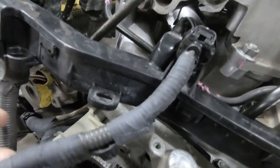You will see in this case here, I've already done some work on this one, because the man sent me the start loom. If I get sent the start loom, I will modify it accordingly. This one is a little bit longer than standard, because the man asked for that. So I've rebuilt it, replaced the knock sensor plugs, and changed it to suit his requirements.